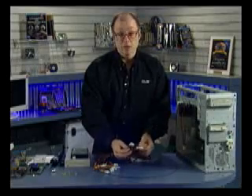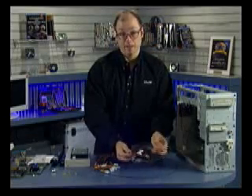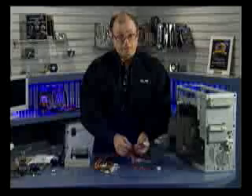Not all motherboards will have all three of these connectors. Some will have just the one 20-pin connector — in that case, the other two can be left dangling and wrapped up out of the way. Some may use two of the connectors. For example, this motherboard is going to use the 20-pin connector and the 4-pin connector, and has no provisions for the ATX auxiliary, so that one will simply be left dangling inside the system.